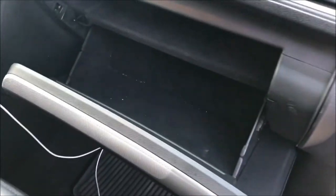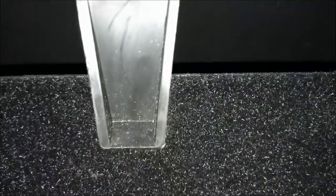So it seems like it's a good idea to change this cabin air filter every time we change oil. There are two clips under here — let's see if I can show it. Here's one, and you'll just push these up which releases the glove box.